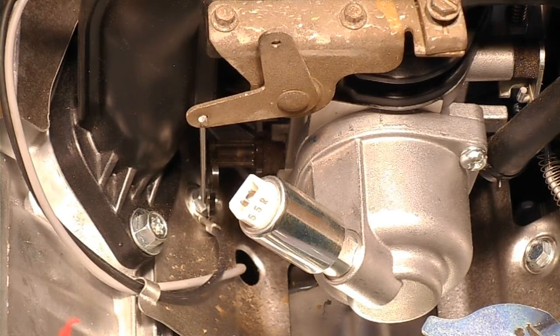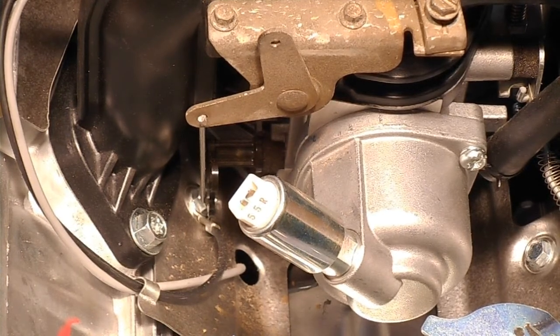I did not want their setup, because if you're sitting there running at that high an RPM when you first crank it and it's been sitting say two weeks, all the oil's in the bottom of it. It's going to take a couple of seconds for the oil pump to pick up the oil and get it to the top of the motor, and I just saw excessive wear in it.